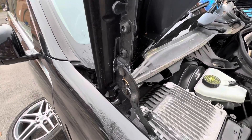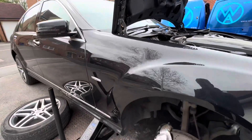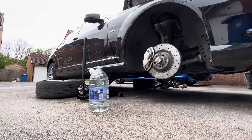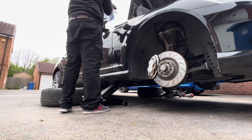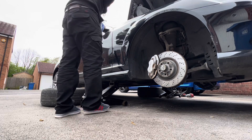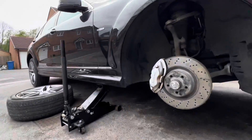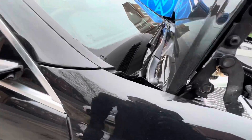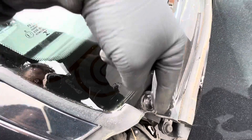I'm just going to do a quick water test — I'm going to pour water onto the windscreen, let it drain through this drain, and show you what we've got. No water draining out. So what's actually happening is the water is backing up inside this drain tube.